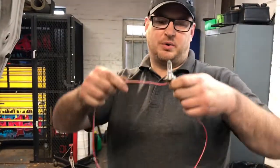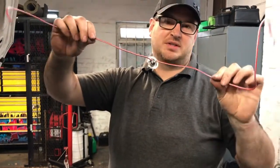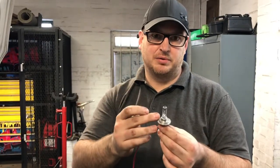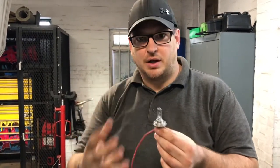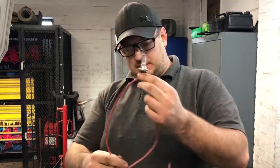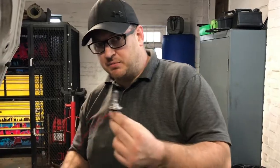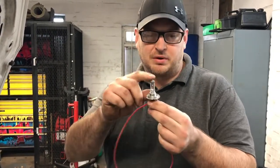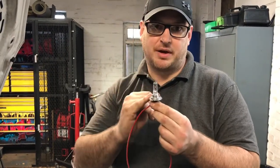This is just a DIY thing — you can buy a test light, they're cheap enough. But you must use an incandescent test light. Incandescent means basically a bulb. The bulb takes the load of any incorrect polarities, so instead of spiking an ECU computer and blowing something up or blowing fuses, the bulb lights instead. That's the whole point of it — this is the safest way to test for powers and grounds.